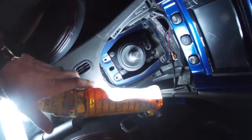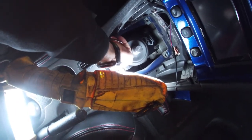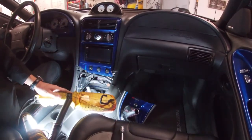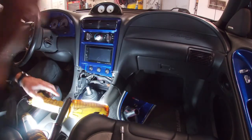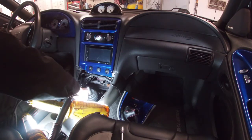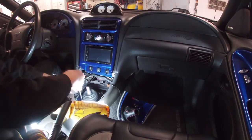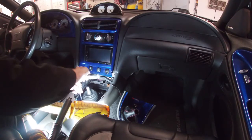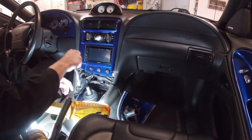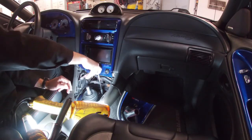I'll go ahead and get my socket and tighten them all the way down. If you have the T45 or T5 transmission, after you tighten this is when you would put those bolts for the stop on the shifter. So I'm going to do one corner, go across, go down to the other corner, and then go across again, just to keep it even.